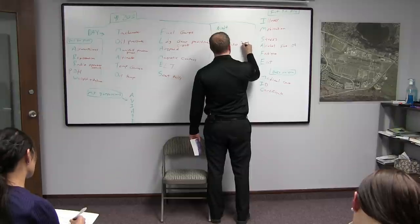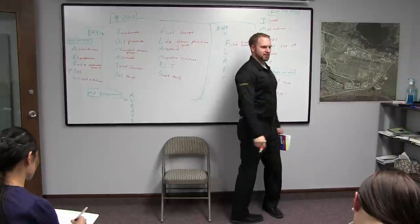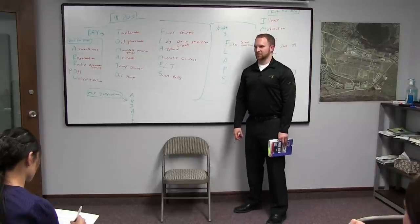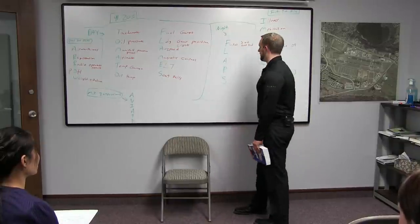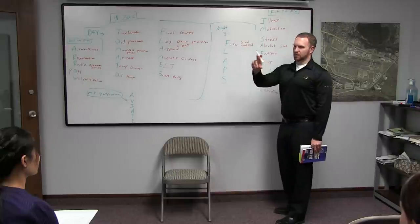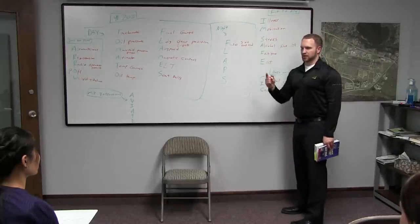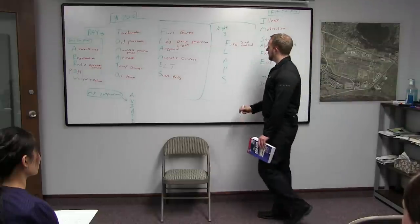Three of each kind. And for a long time, I kind of pondered this in my head and go, well, we must have spare fuses in the plane and have three of each kind, but I could never find them. They were never there. They weren't in the glove box. They weren't anywhere in the plane. That means three of each kind in the panel where the fuses are located. You need to have three matching. So if they're 20 amp fuses, you need to have three of them in there. That way you can mix and match.